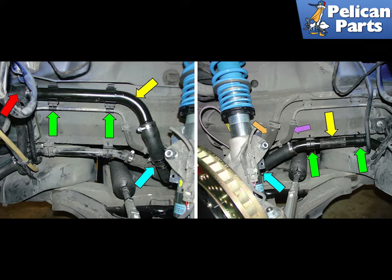These two photos show the left and right side of the inner wheel wells with the larger radiator pipes installed. In addition to the larger diameter pipes, you will also need to install the plastic large diameter pipe retainers. One end of the pipe attaches to the new 3-way radiator hose, and the other end of the pipe attaches to your custom-made hose with the reducer piece installed.